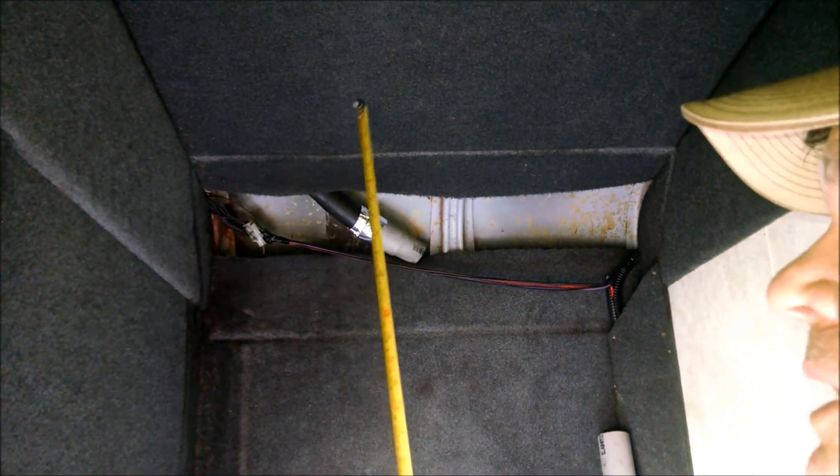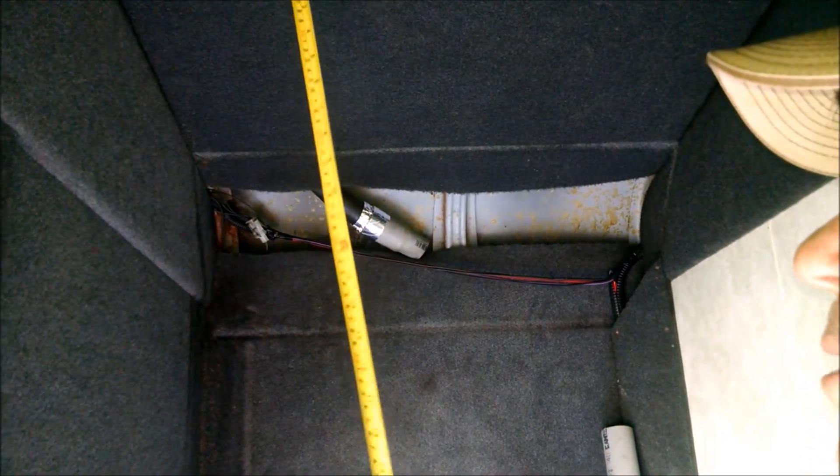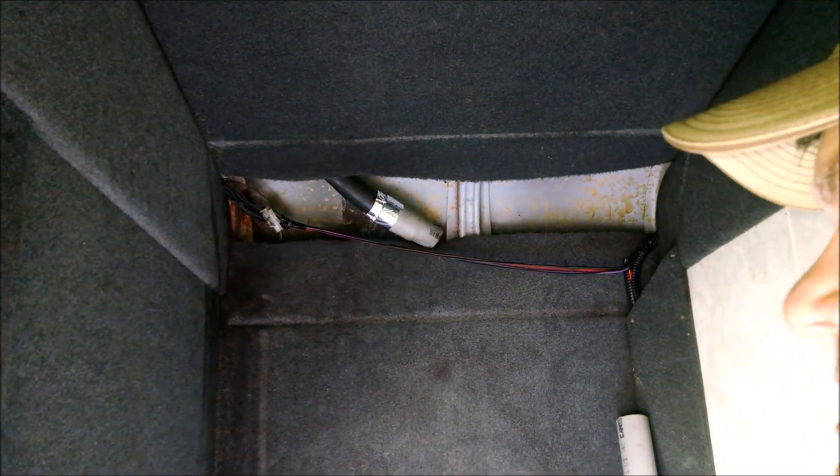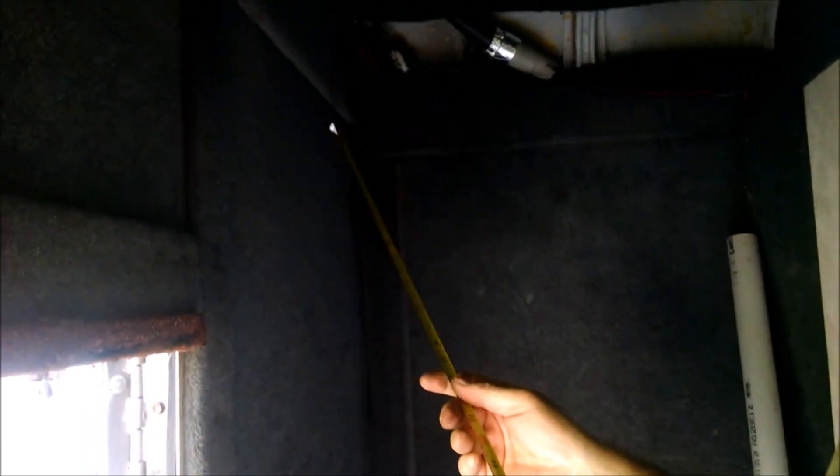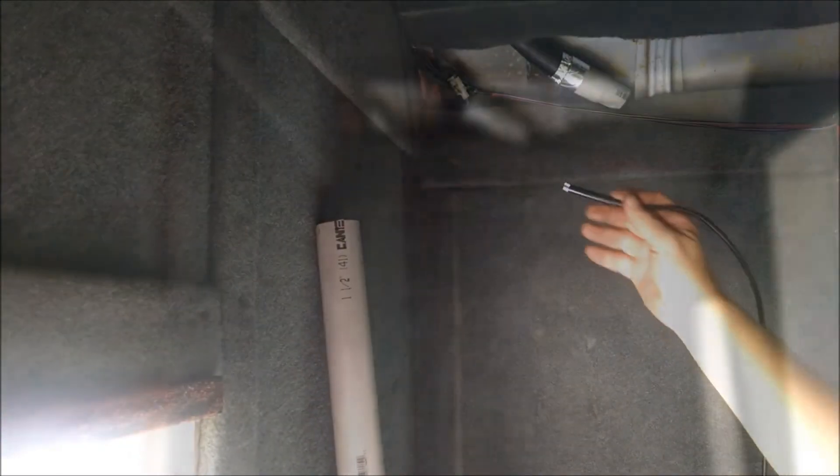There are numerous braces — not just the tubing braces, but also steel slats that run through — and I was worried about trying to clear those without getting too far out into the compartment. There's really no room to vent inside the walls; it's too narrow. So my plan is to just take this vent, elbow it over, follow the sidewall, and 90-degree it out through the back wall of the shuttle, then put a weather cap on the outside. That's just providing vent for the black water tank so that when it drains, it'll drain properly.